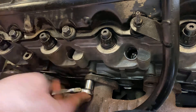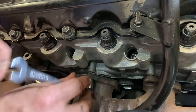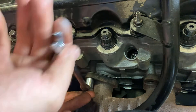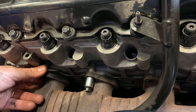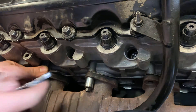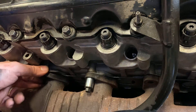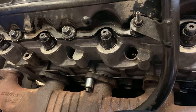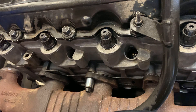I'm getting the rest of the bolts in and lining them up. I hope this helps and I hope somebody finds value in this — I didn't find another video on the internet about it, so hopefully this gets you in the ballpark. I didn't tighten the first bolt too much, just enough to keep it in position so I can get the other bolts started without it falling. Ford recommends starting with that smaller hole bolt — it kind of floats the manifold and gives you a nice balance so you don't have to fight it too hard.